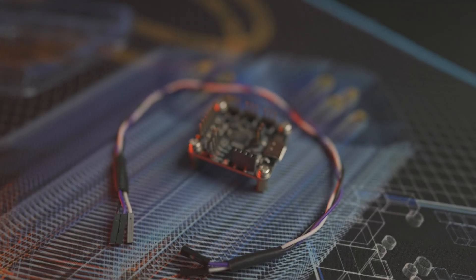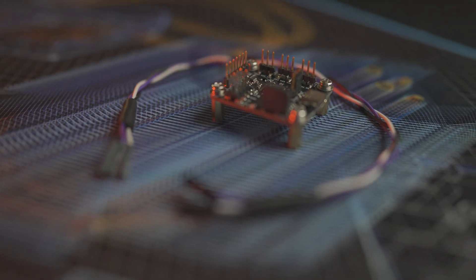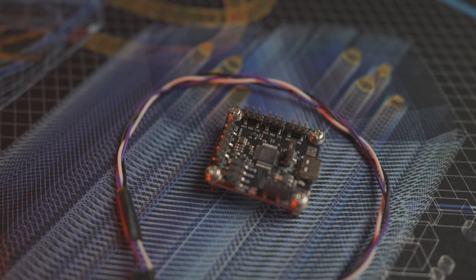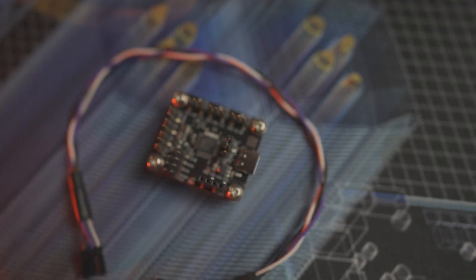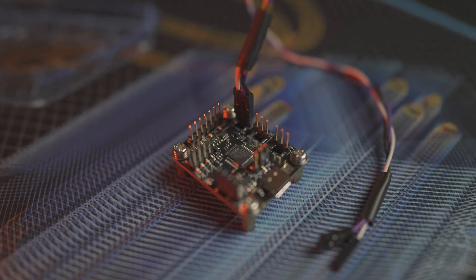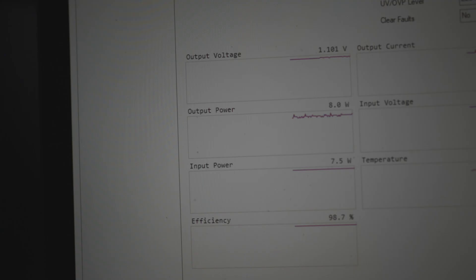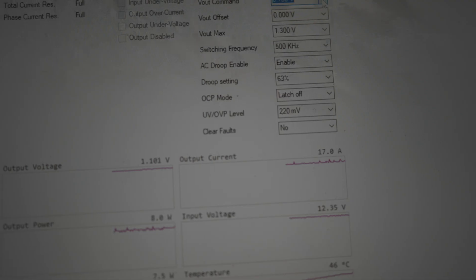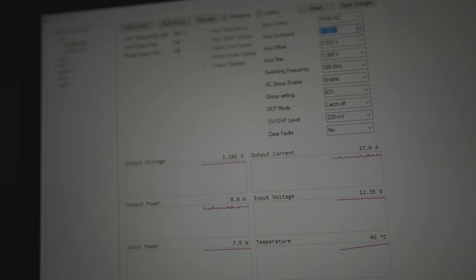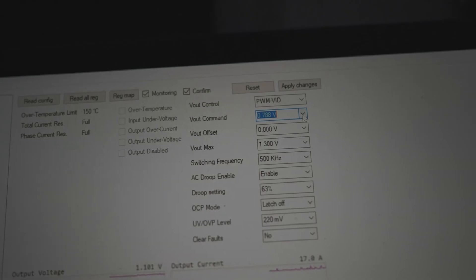I give you the Elmore Labs EVC-X2. This is the newest version — I've used his original version all the way back in 2012 or 2013. This gives the ability to fully control your card. If it's available on the I2C bus, you're pretty much able to access it. It can control all the voltages. We get access to the switching frequency, OCP and OVP settings. We also get load line, not just on the GPU itself, but also on the memory, so that's going to help with efficiency. And since these GPUs are pushing so much current, having access to these settings is crucial.